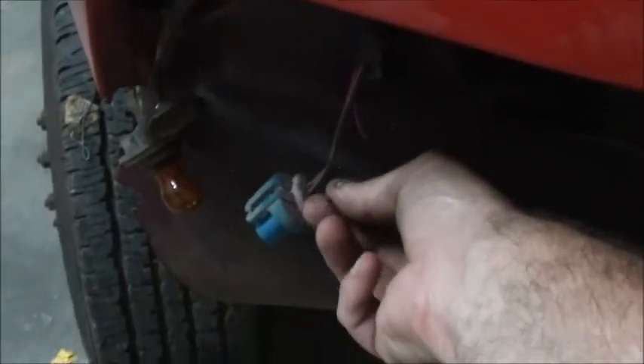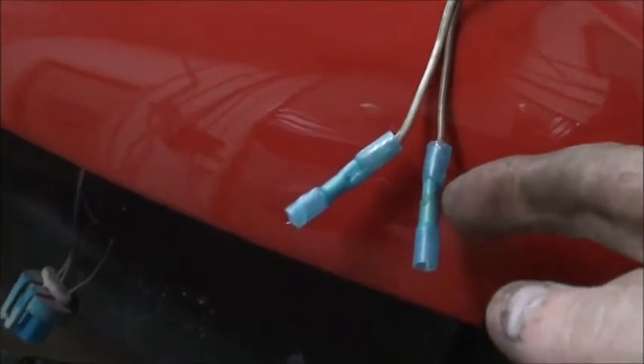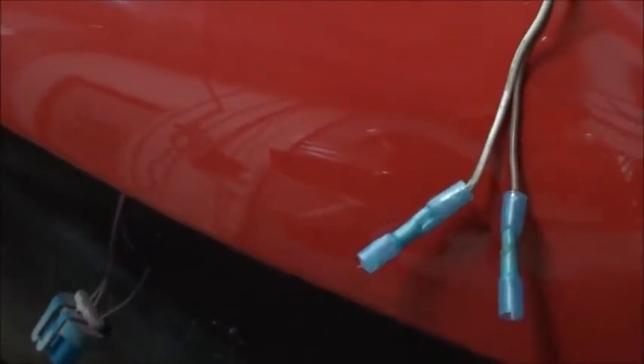What I did is I had about a 10-foot piece of trailer lighting wire, which is 4-wire, 14-gauge — plenty big because these are actually 18-gauge to the headlights. This is the feed to the high beam. What you have to do is basically cut it, run one back to the box to the bulb, and one back to the box from the power in the truck.